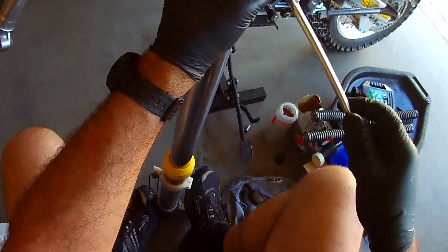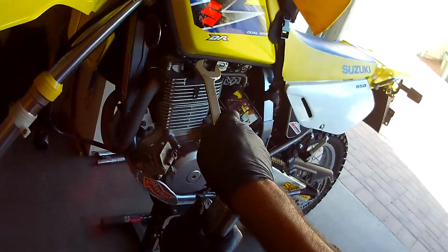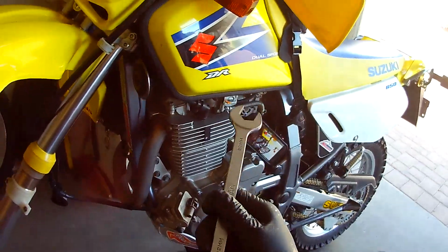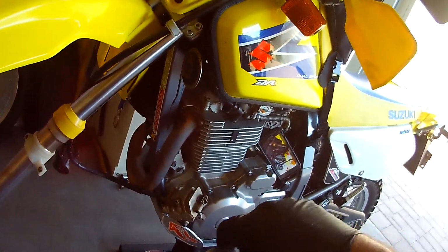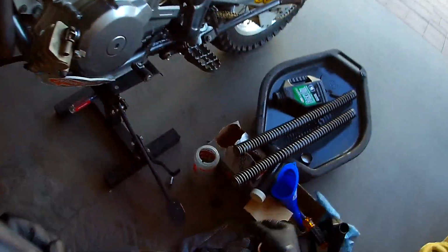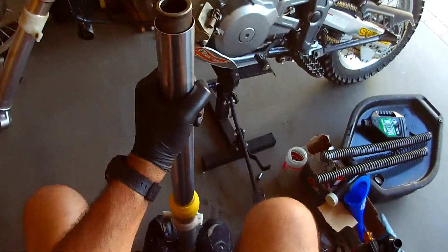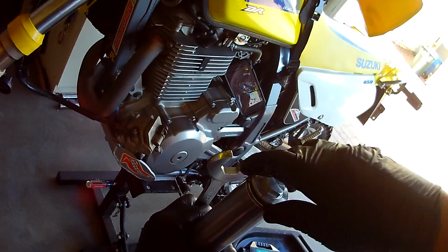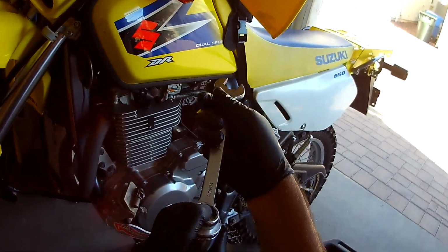That's just not right. So if you're doing one of these things, do like the instructions say, and put this, was it CDD, the Cogent DDC. Okay, so put the drop-in cartridge. So put the cartridge in first. Put your spring on. Put that little washer on, and then, no matter who you hear it from, at this point, put the Suzuki spacer in. Because I measured it, that gave me my 8 millimeters of free play here at the front, I mean, under the cap. So, everything points to running it like that.